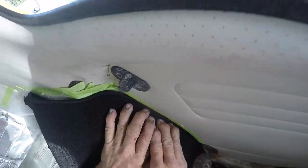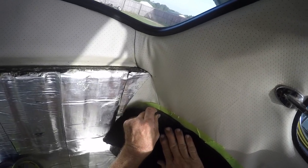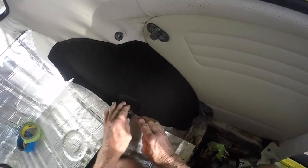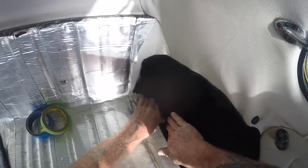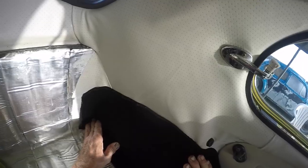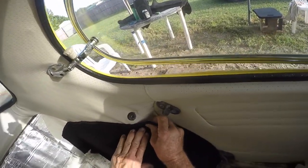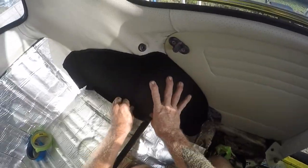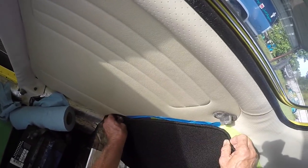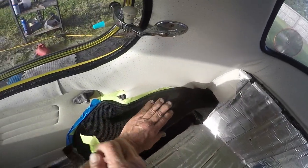Let's start here first. We can pull it back off and give us a better bite. That is much less wrinkles in that area than I did the last carpet job. And you see I don't have a glue mark up there — it's above the fender line, so it'll stay and keep from coming off that fender well. I'll pull this up a little bit and get it stuck in there a little better. I like that. I want to come in here with a razor blade and trim some of that off, and get my tape out of here before it doesn't want to come out.